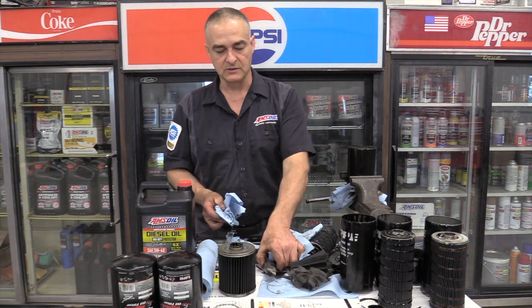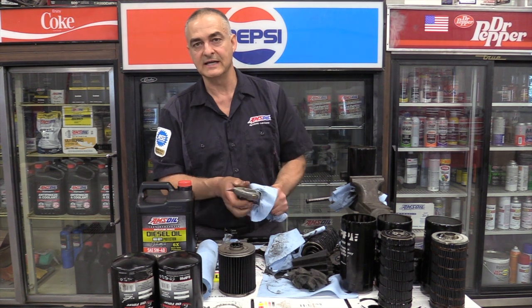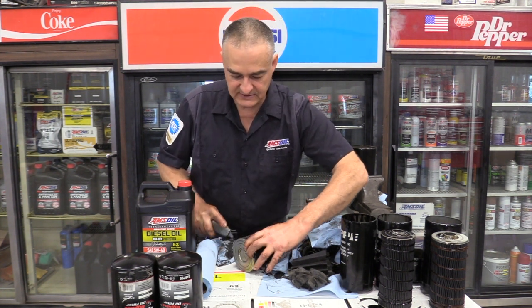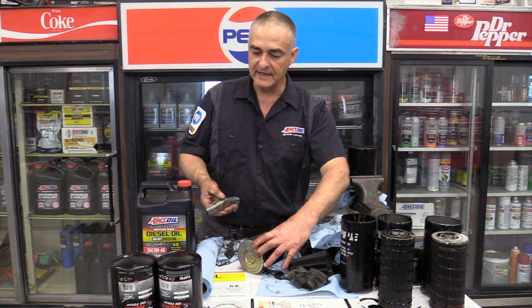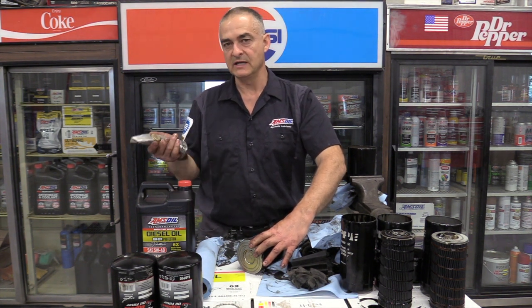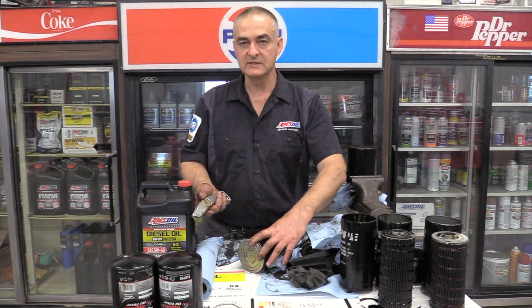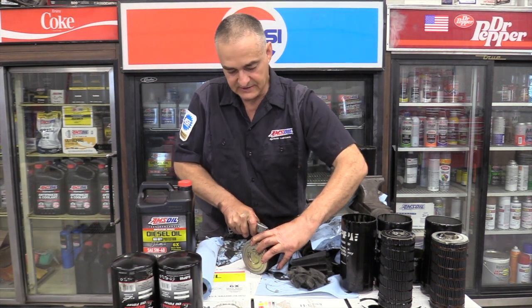Here's the bypass filter — this is a short one. I use the short one on these diesels because when we're only running 18,000 to 20,000 miles, these are fine. The next length filter is about an inch and a half longer, and then the next one after that's another inch and a half longer — that's the 110. So this is the EABP 90, there's an EABP 100, and an EABP 110. You can add more oil capacity with the bigger filter but you're also spending more. The biggest thing stopping us from doing longer drain intervals right now is the TBN — the base number of the oil, which is the reserve alkalinity that neutralizes acids. We're getting down to about 2, and it starts out at about 11 on new oil. When we get down to 2 on the TBN at 18,000 to 20,000 miles, you are going to get flagged by the oil sample results. That's due to the new formulation of diesel oils starting in 2007, which backed out some of the additives that give you a higher base number.